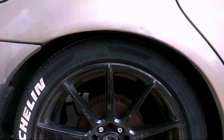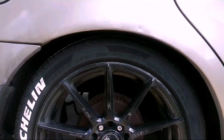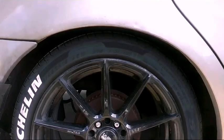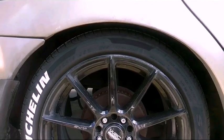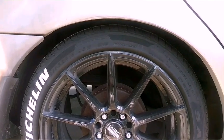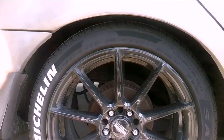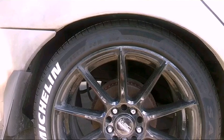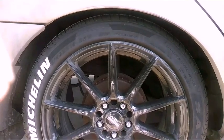There are both lowering springs and coilovers available, but they stopped making them for this particular year. If you're looking for one for your car, go for the 1996 to 2004 Taurus lowering kits because they use the exact same suspension and it will fit with no modifications needed. The bonus for the 4th gen is that when you put those suspension parts on your car, you'll get about a quarter to a half inch more lowering compared to putting them on the '95 to '99 models.